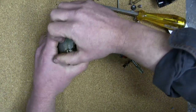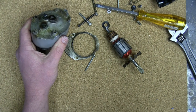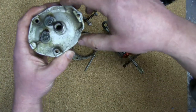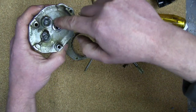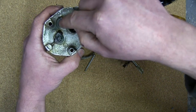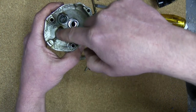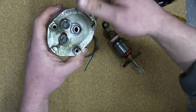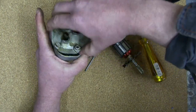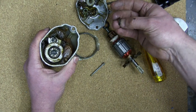Of course, now you just get a plastic tube full of these kind of gears. This looks like a spur gear arrangement that's offset. So it looks like an idler here. I'm guessing input to an idler. So small, big gear connected directly on that shaft to a little gear, which drives a big gear here. So that's where your reduction comes from. That's what I'm guessing. I've been wrong before, but not this time. There we go. Where did that come from?